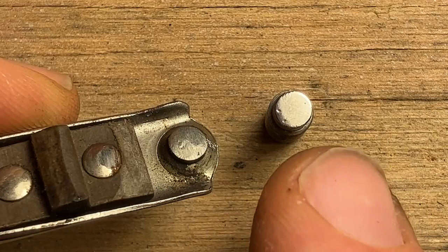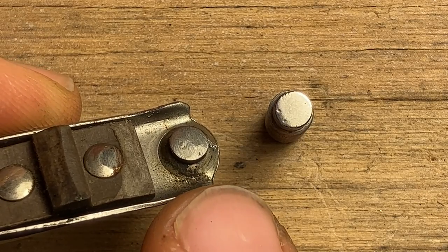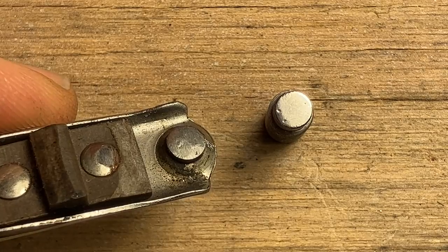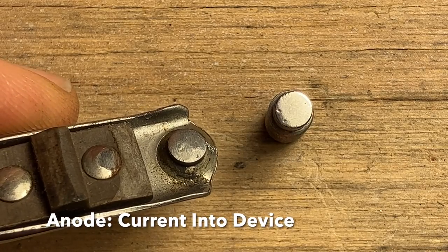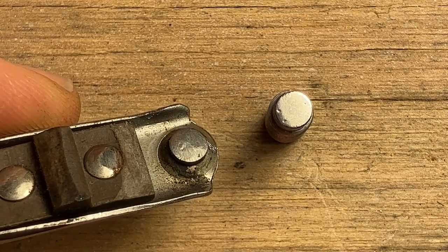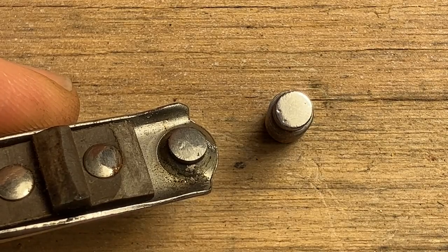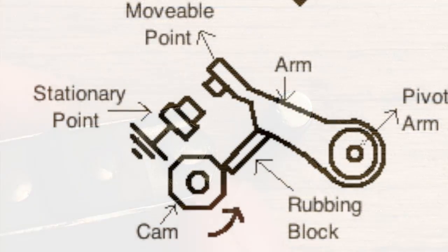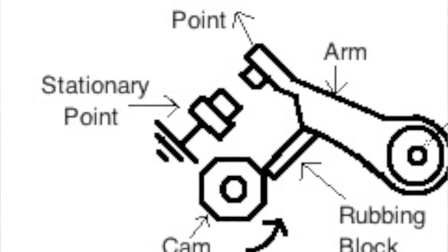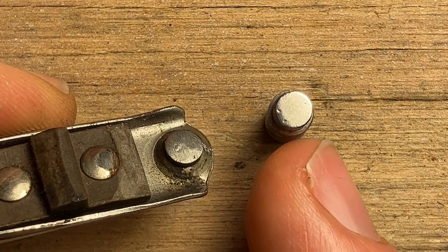This is the anode and this is the cathode, and material is always transferred to the anode. The point arm is the anode because current is flowing out of it. There's a mnemonic — ACID: anode current into device. If you remember how a distributor is put together, current is flowing from the ignition cable down into the lower plate, then up the pigtail and into the arm, then across to the point block where it grounds and goes back to the chassis. So you're seeing a very classic electrical arc where material was being deposited on the arm because that's where the current's coming from, and it's going into the ground at the point block where there are pits.